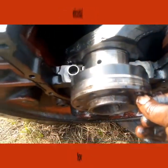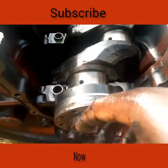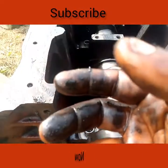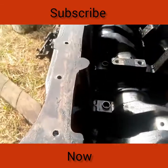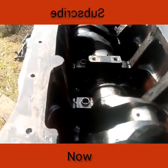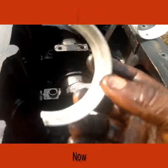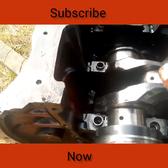You must make sure that your crankshaft is properly fixed. On the upper side, that is where you fix the thrust washer. This is the upper main bearing — the main bearing here. The cap is equal, there is no up-and-down difference in this one; it is equal and you fix it properly.